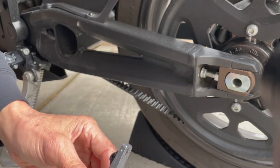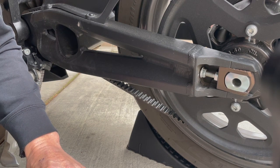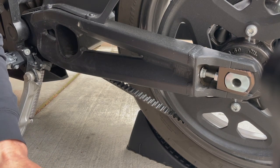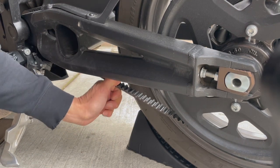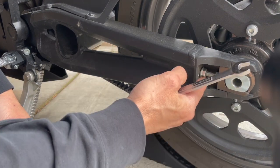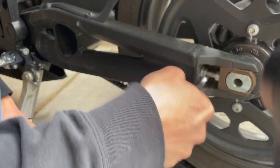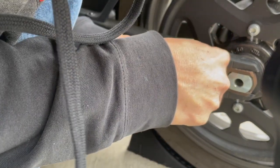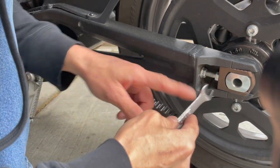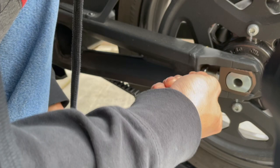So it's about 100, so I'm good - that's within spec. The spec for the Zero says between 25 pounds and 175 pounds, which is a really big range. I don't like that big a range, it should be tighter, but anyway this is a lot tighter than it was before. Now I can basically lock my lock nut back up again. This is so much easier than a chain. Make sure this flat doesn't move. I only have one 13 millimeter wrench, unfortunately - it'd be nice to have two so one holds it and the other spins it.